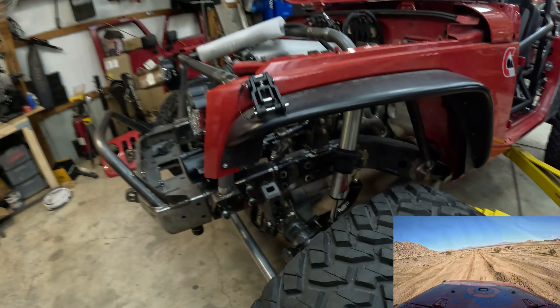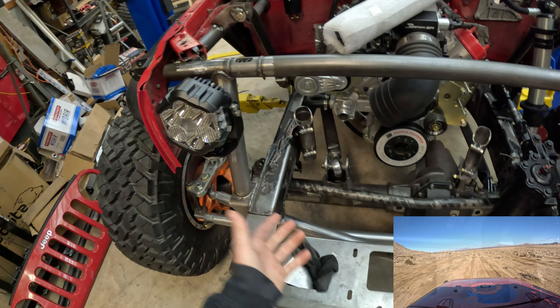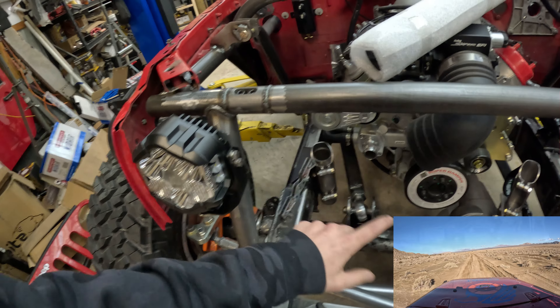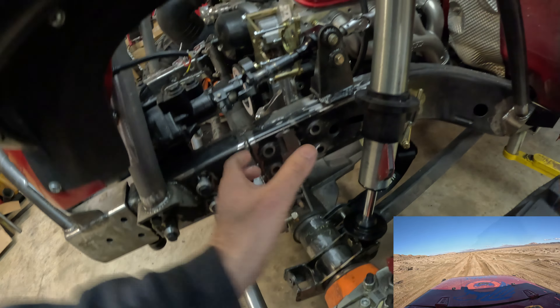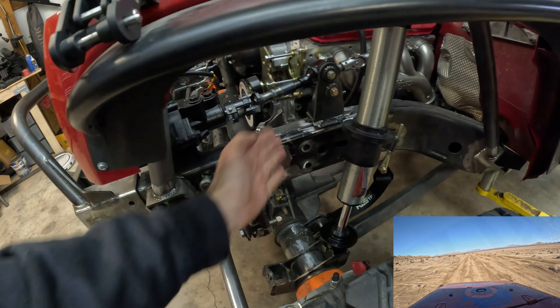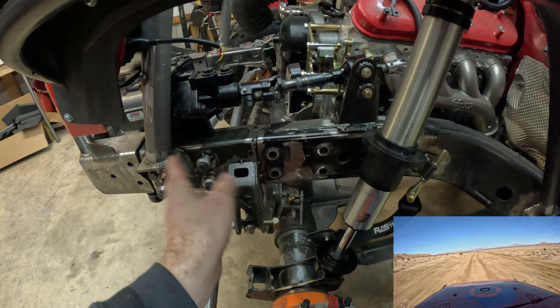Today's project is figuring out how to put a bump stop on the driver/passenger side inside the frame. We need to cycle the suspension to make sure the upper link mount clears - the weight of the track bar moves the axle, so everything should be good, but I want to check before we burn it in. Over here there's just no room and we're playing with the devil. We could notch the frame to flush-mount our bump stop, but that technically weakens the frame at that point, and with everything going on up here I don't want to create a weak spot.